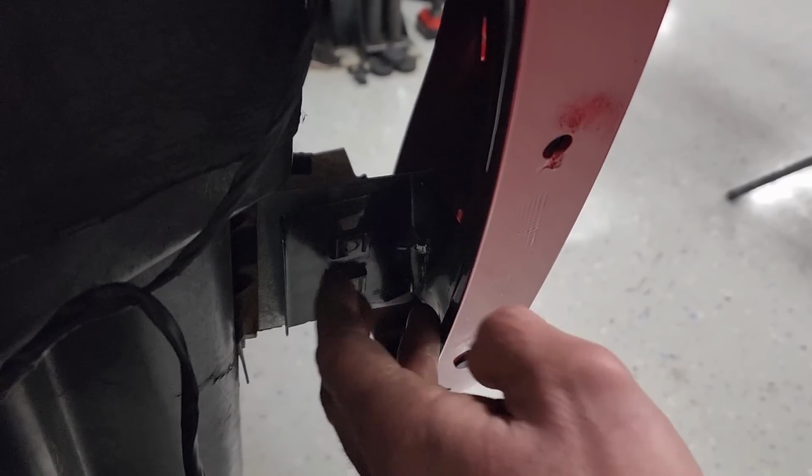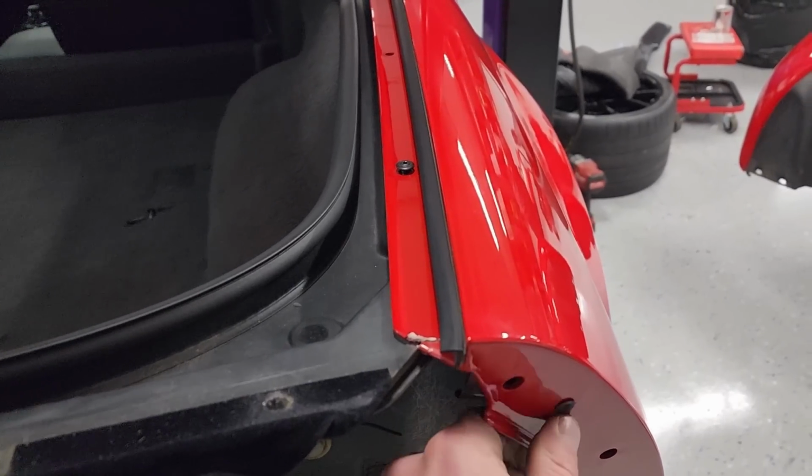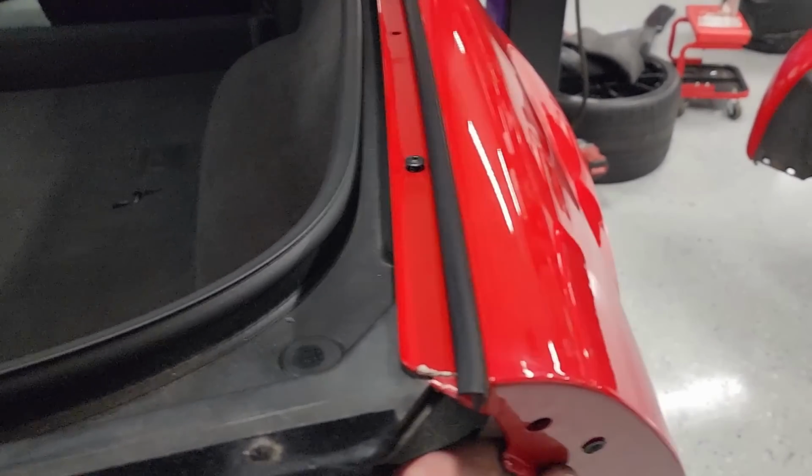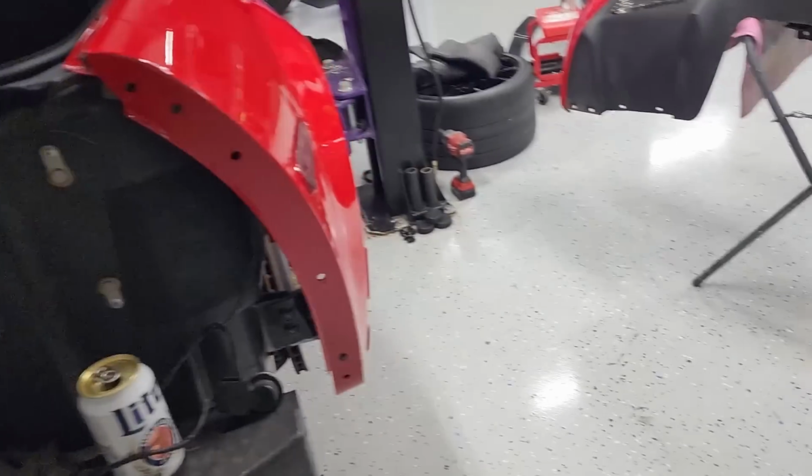And anyways, quick work in the vise. This is just real thin sheet metal. Got this thing straightened out. Nice fitment on the plug there. Matches the other side. So I think we're good there. Left this loose up here as far as the fender, just so we can match it perfectly to the bumper when that thing goes on, which I think it's ready.